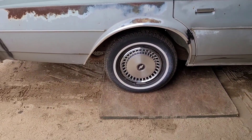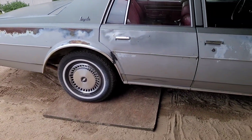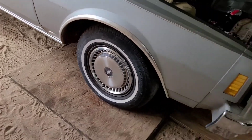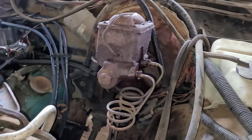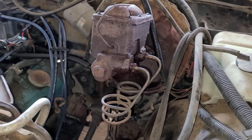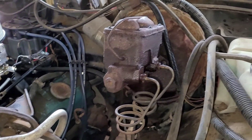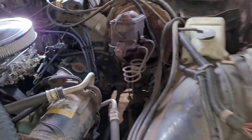What we're going to do is get the brakes straightened out on here. I'm going to take the back wheels off, but I don't have any wheel cylinders or shoes to put on yet — I'm just going to do an inspection. If everything looks good I might leave it. I definitely got to address the front, so I got calipers, brake pads, wheel bearings, master cylinder, and brake booster to go on here. I don't know if I'm going to try to bleed the brakes today. Right now I'm just letting the bolts soak because they ain't been loose in I don't know how many years. I don't want to risk snapping anything off, so I'm going to spray them again and then get the wheels off.